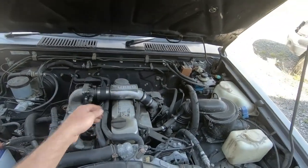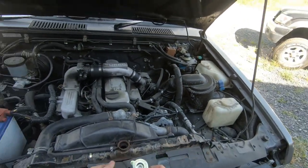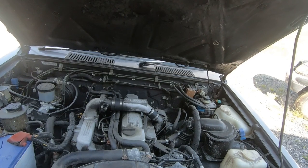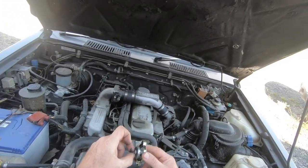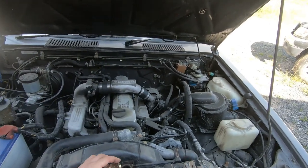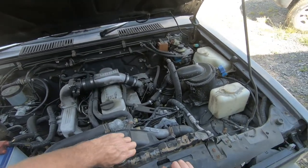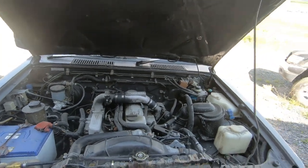That's going to fix that part of the problem. We'll also sort that hose, change the crunchy heater hoses, flush it, and change the radiator. But the easy fix for a lot of jobs with those symptoms is to just put a radiator cap on it. For the few dollars that they are, it's cheap insurance — or if it's 10 years old, maybe just put another radiator cap on it. Hope that's helpful!